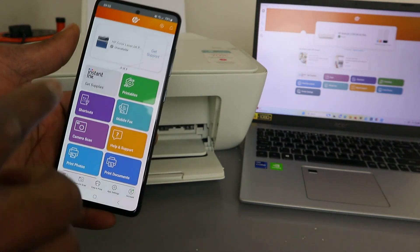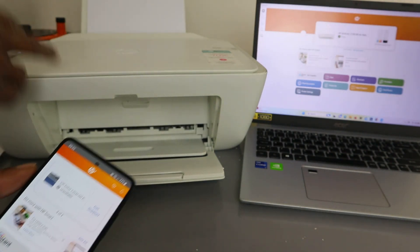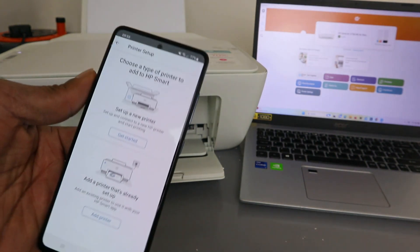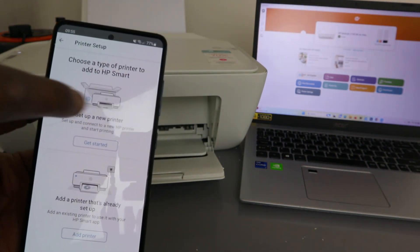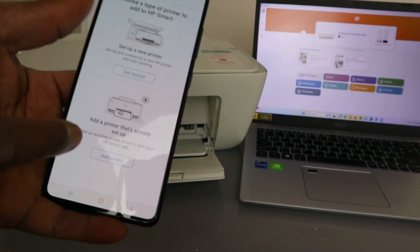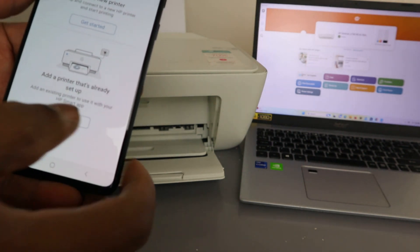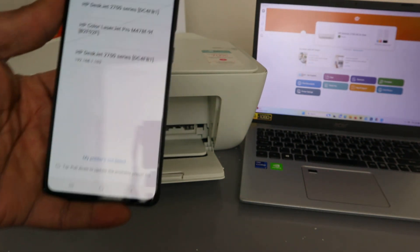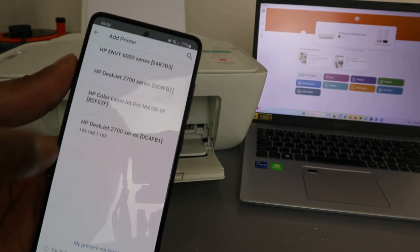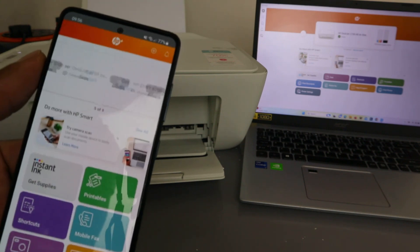Select the plus button to add this printer. Go to the top and select Plus. It will ask you to choose the type of printer to add — set up a new printer, or add a printer already on the network. Select 'Add a printer already on the network' and it will search for available printers. Select the HP DeskJet 2700 that appears.